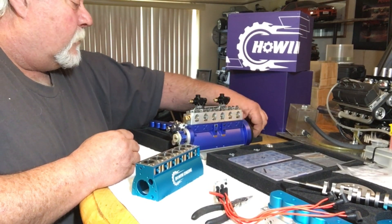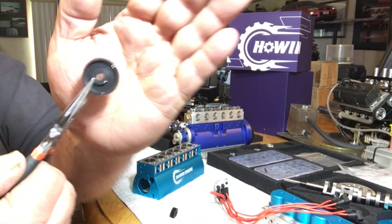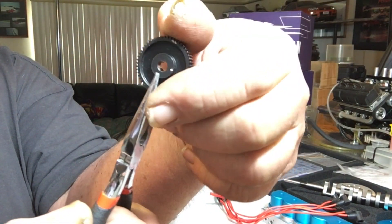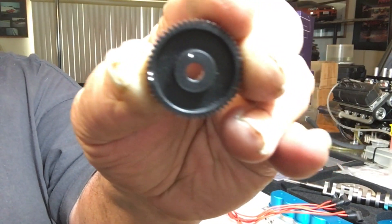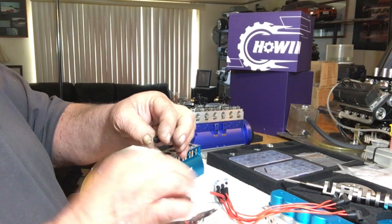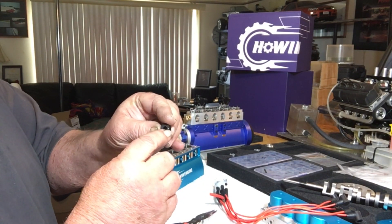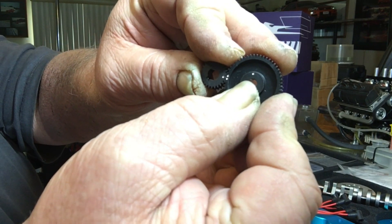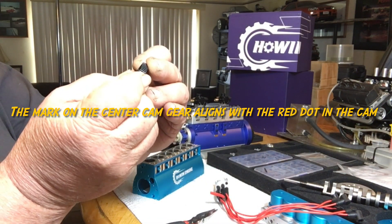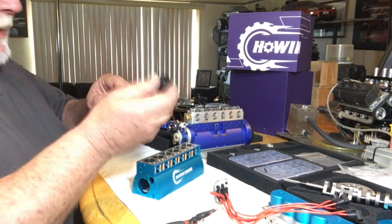The timing gears for the camshaft and crank now have marks — there's three marks on the cam gear and one or two on the crank gear where you set your timing. From what I gather between the two engines, this little dot on the bottom of your crankshaft gear goes in between those marks to create a three-position notch. On mine I had to kind of turn my camshaft by hand until I figured out the cam timing, which took quite a while. The production engine still has the one-way bearing starter on it with a gear, not a belt, which is good.